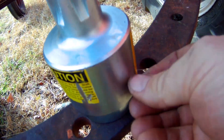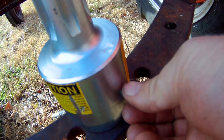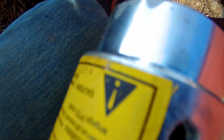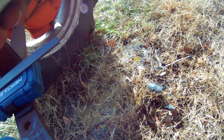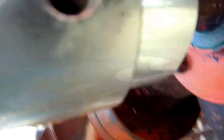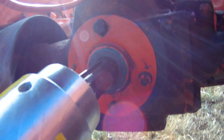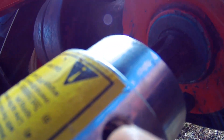When you get ready to do one of these, take your grease inserts out — at least one of them. Set that right there so we won't lose it. If you'll notice, see that hole? It's a little offset, but let me get it all lined up here. Line that up and get it on your spline — I'll probably have to tap this on with a hammer. Line this hole up with that hole on the spline, obviously.